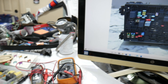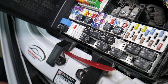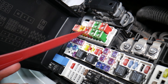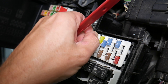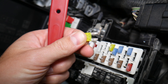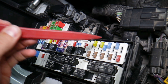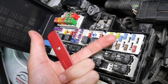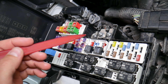Let's explain quickly why it's always a good idea to test fuses and relays. It is very important to test them. On those fuses, you cannot clearly see if they're burnt or not, especially on JCase fuses. If you remove a fuse, look at it, and assume it's a good fuse — but it's actually a bad fuse — sometimes you cannot clearly see that. At that point, you can put the bad fuse back in and start replacing parts that you don't need to. You will lose time and money fixing a problem that doesn't exist, when all you have to do is test the fuse and replace it.